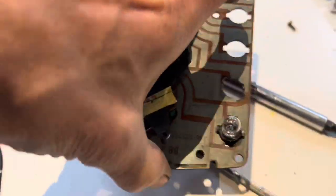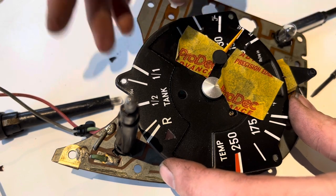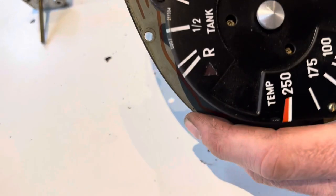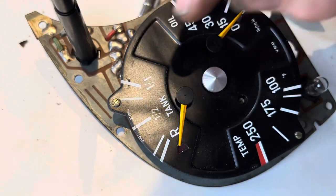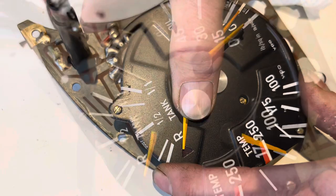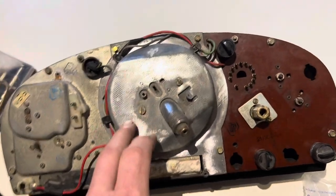We've done up those four screws and connected the gauge to the circuit board. We just have to remember we're going to put on the oil pressure sensor — we've lined this up, pressed the needle down firmly. There is a very small bit of movement before you tighten these screws; what you need to do is make sure those two pins are completely central. Hopefully you'll have made a note of exactly where these were when you took them off. This one was just on the edge of that red triangle — pressing it on firmly — and this one when we took it off was just between the two zeros.